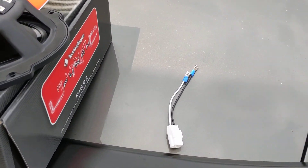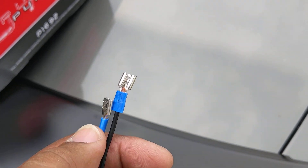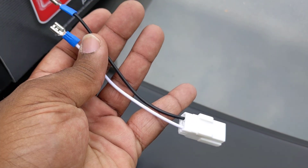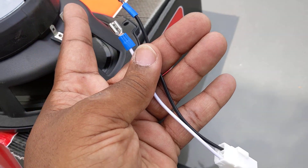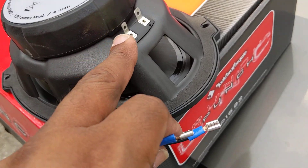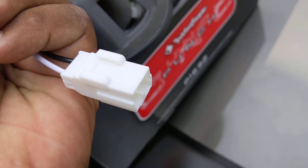One quick thing I like — I usually order from Crutchfield, sometimes Sonic Electronics. You always get a quick wiring harness just to pop in, makes it really quick. The only thing is you will have to cut the connectors that come attached, because they're not going to be big enough for aftermarket. Some speakers have four tabs where you can just — well, I'll say it's the design. They know you're running power to this, so they don't have all those extra little tabs. Some of them have four; you would have to cut the other ones off, put bigger ones to fit in here, and just pop that sucker back in from the factory attachment.